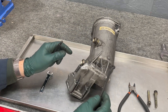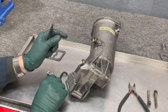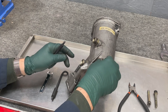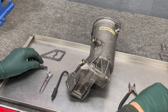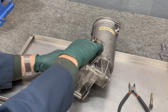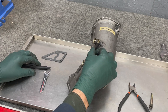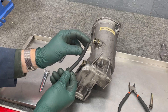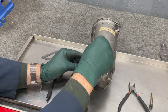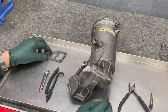You're now going to have to transition underneath the car to complete the installation. There's a clearance problem against the steering box, so this is what this modified tool is for — this is why it's been cut. You can start the center bolt with a wrench or by hand. Make sure the gasket stays centered. Once the center bolt is started — you don't have to run it all the way in — start the next bolt up here on the top forward side. Push it in, make sure it goes through the gasket.